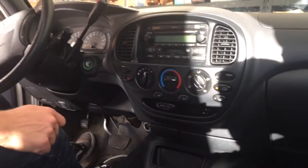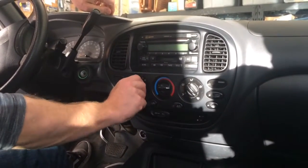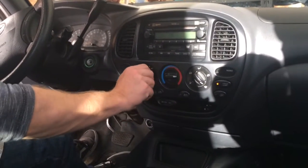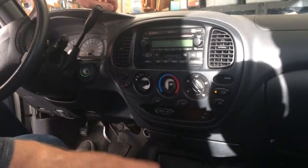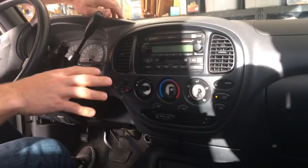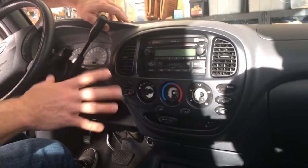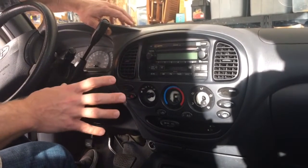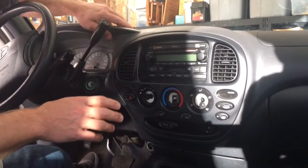Okay, so the first thing we're going to need to do to pull the stereo out is remove the knobs, and these are very simple. These three knobs here for the vent controls just pull right out. You don't even have to pull very hard. And I've already been doing some work on the stereo. I just added an auxiliary port here the other night, and I show how to do that in another video that you can see in the link below. I'll put that on the video.